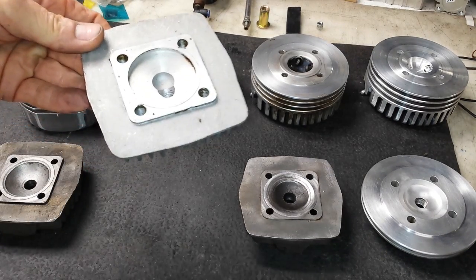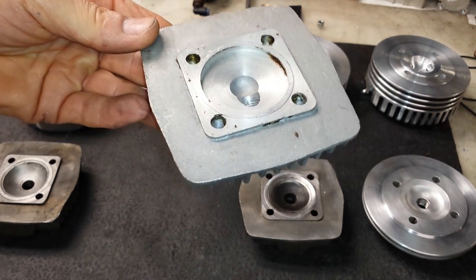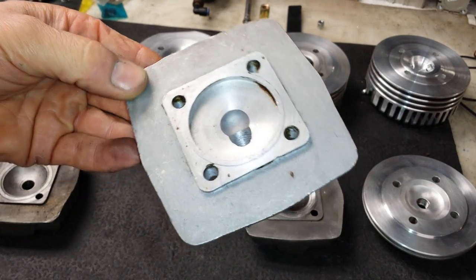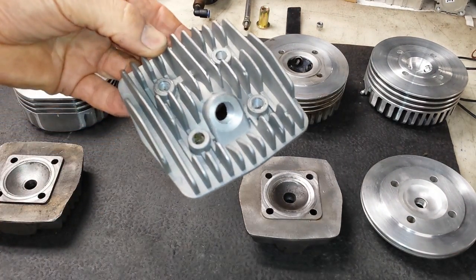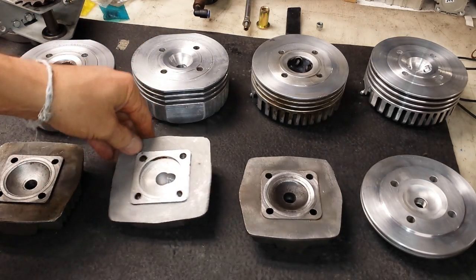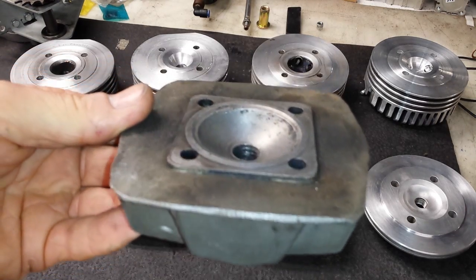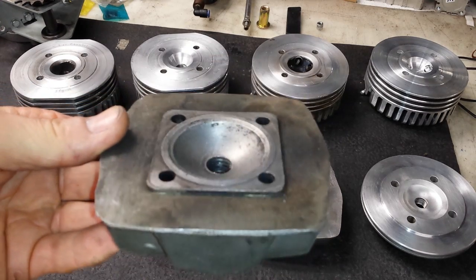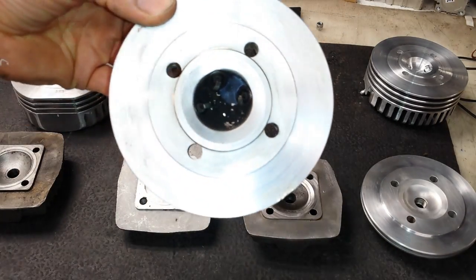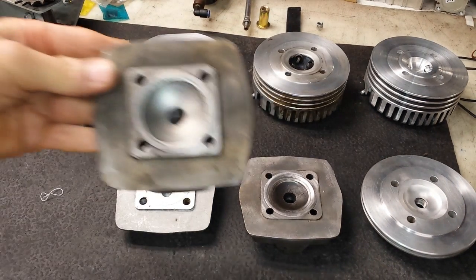This version here is the angled plug version. It is a relatively high compression cylinder head, but that's partly because the angled plug cylinder head is used to fit into tight spaces with space-restricted frames — by its design it will automatically be a high compression cylinder head. And this is the low compression version, the standard type cylinder head you'll find on pretty much any two-stroke motorized bicycle engine. Quite a deep dish, lots of volume, low compression. Having said that, the three-hole variant of the CR Machine Manufacturing cylinder head has less volume and higher compression than the standard low compression cylinder head.